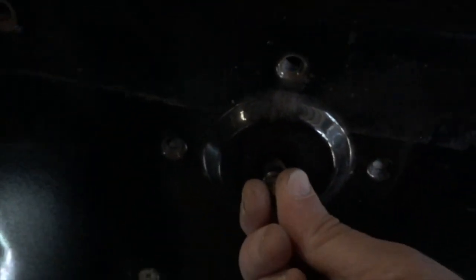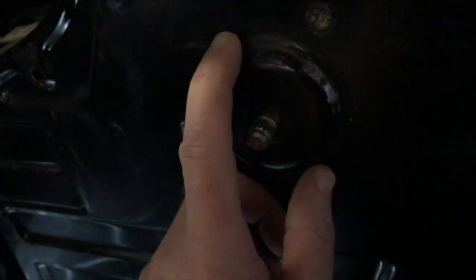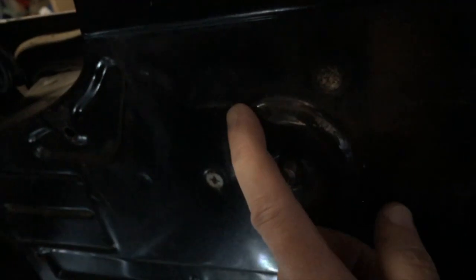Alright, I still have the window in the up position, so now that I've removed all these bolts, the 3 that are here, I think this is just going to push in and then come right out. Let's take a look. Alright, so the issue is the arm for this is still in the way. So what I'm going to do is drop the window while these screws are still in here and secure. Then I'll unhitch the window, leave it inside the bottom of the door here. Then with this undone, I'll be able to undo this, take it out, and then I can get to this. There's a bar that comes behind this mechanism right here, which is pinning it inside, so you actually have to take the window off first.